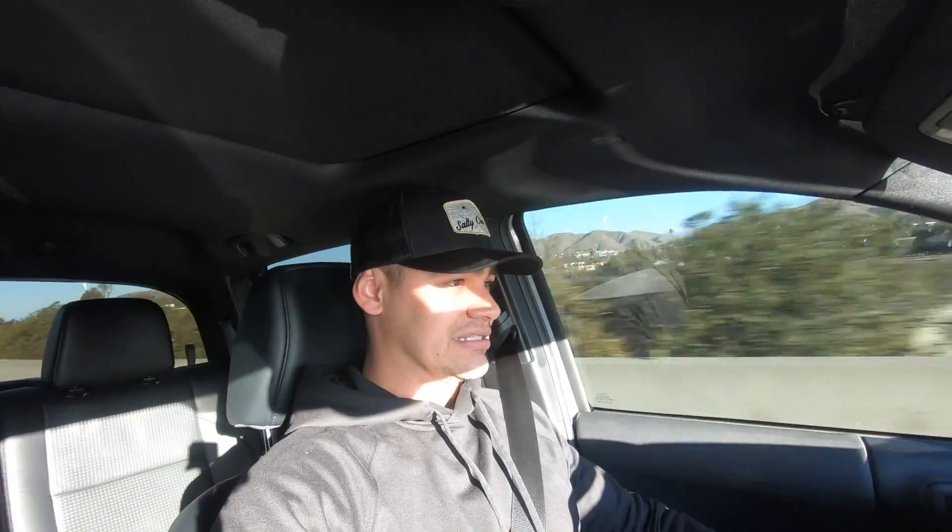I'm thinking of having them raise the height of my lift. I'm at about two inches right now, so maybe go another three-quarters of an inch to see if that'll help. However, that might reduce some comfort in the suspension. Also a possibility for a Viper cut — if you don't know what that is, it's basically a front bumper cut you can do on your own. It looks like a Viper, and it does look pretty nice, which will give more height and wheel clearance. There's also the potential for a full bumper cut and getting an aftermarket steel or aluminum bumper, but that is a lot of money and I'm not ready for that right now since this Icon lift was very expensive.